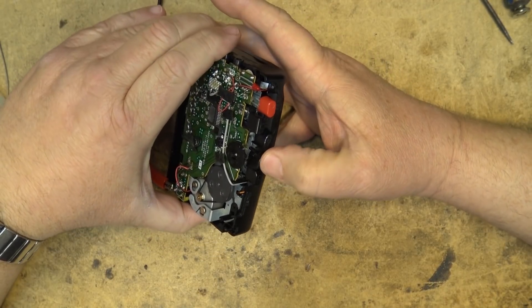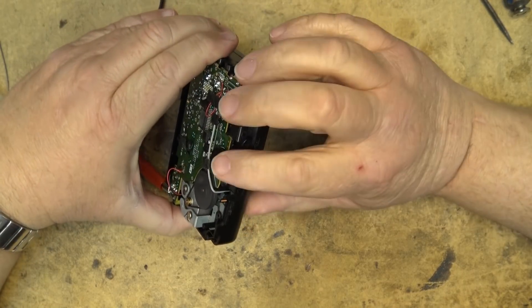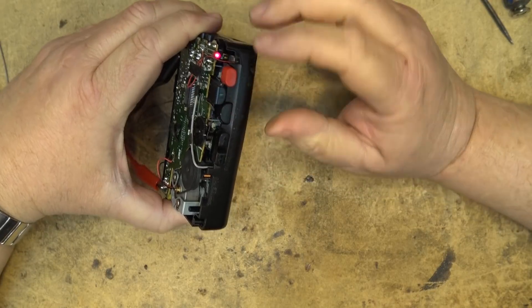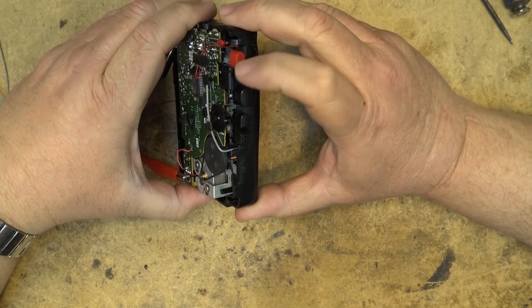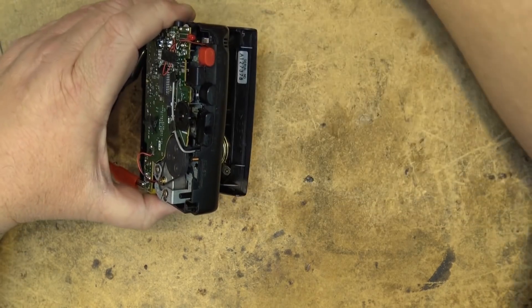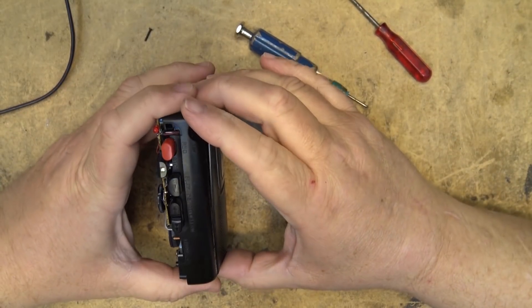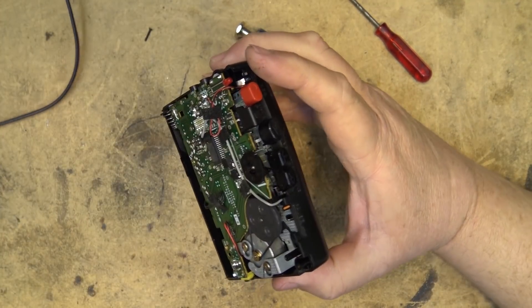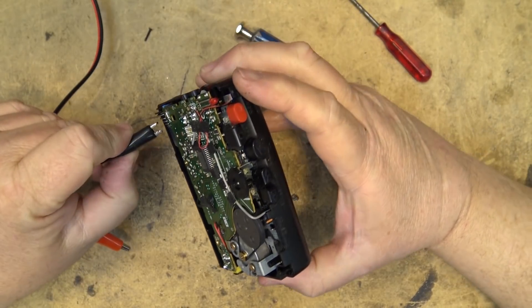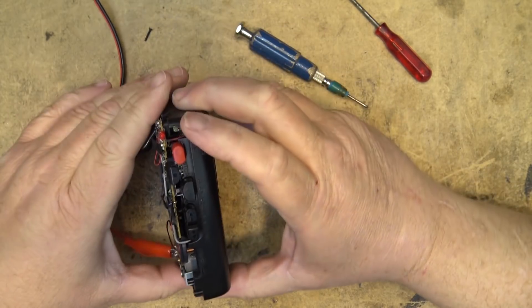And then rewind it a bit. Testing, one, two, three, hello, hello, how's this thing sound? The motor makes it sound pretty bad because the motor is shot on here, but we got the thing to produce some sound. So that's it on this one — that's the end of the road for this little unit. We say it works, but it's a bit noisy on the motor. That's just the motor causing that because the brushes are basically worn down.